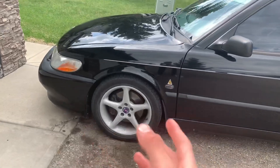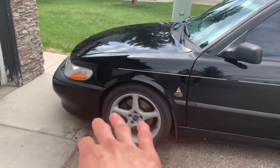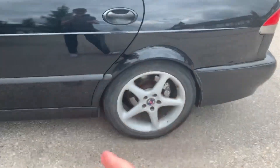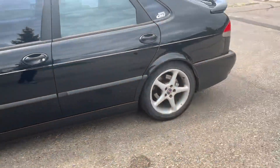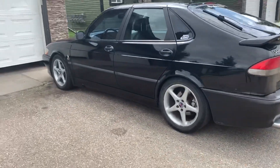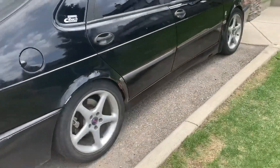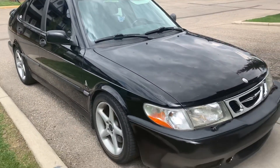I did mention at the beginning of the video — I put Eibach lowering springs on my Viggen. They're supposed to lower about an inch and a half to an inch on a Viggen. The front doesn't look too slammed but still looks a lot lower. The rear is where it really starts to tuck. It doesn't scrub on 225s — I think you'll be fine with 235s too. It definitely makes the car look a lot more aggressive and handles noticeably better. I got them for $100 out of a shop. If you have any questions, leave them in the comments. Thanks for watching, see you next video!